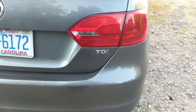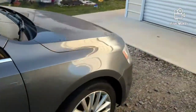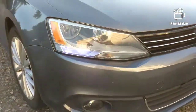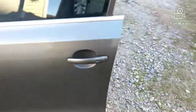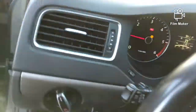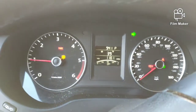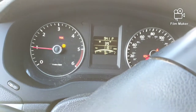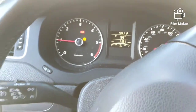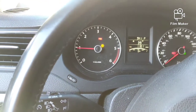That one should be blinking — we have nothing. Now, if it's doing a fast blink, first thing to do is come out and check if it's the front or back that's blown. If the front is blown, nothing will happen and the back will be blinking real fast, or vice versa. I don't have somebody here with me, so I can't hold the brakes and show that the brake lights aren't working either. But go ahead and test your fuses and I'll show you which fuse it is.